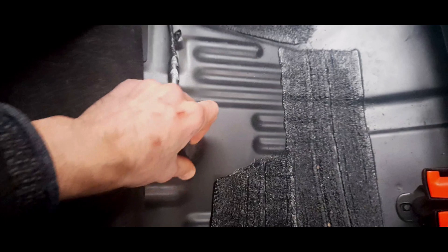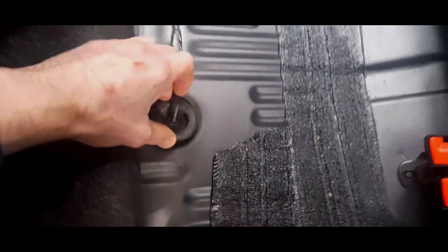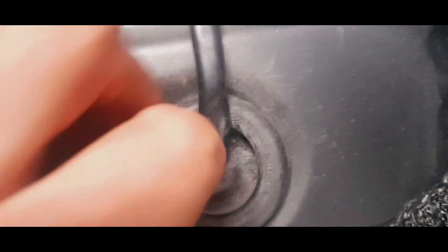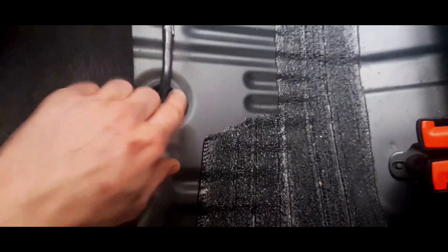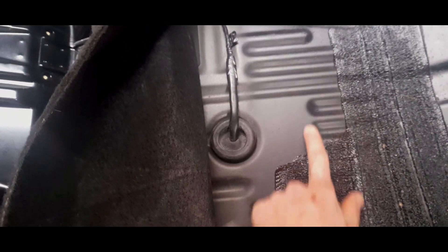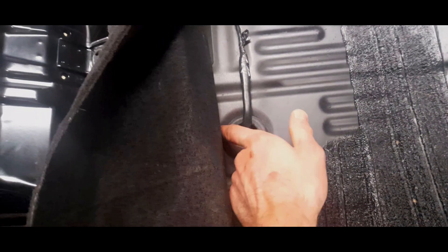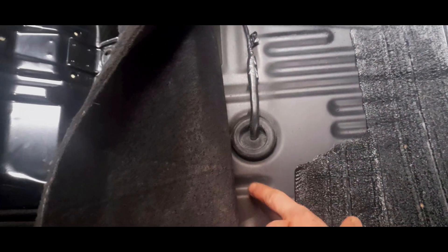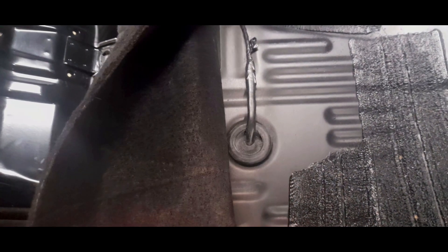It is just a grommet — and prying it up just takes a bit of peeling away and it comes off. Under there really is just the fuel tank connection at the top of the pump. That's all it's for: to disconnect the wiring. What people do is cut this square piece out, maybe up to here, using the Dremel and tin snips, and oh my god, it looks awful.